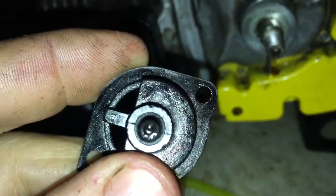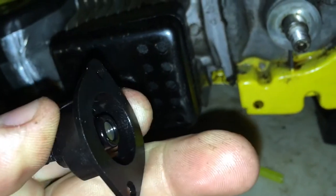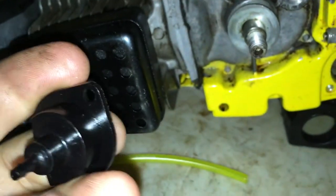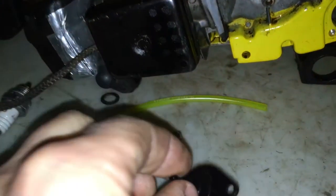I don't think there's a duck bill in here - I think it's just a ball and spring. You might be able to take a small punch and punch it out. I just tapped it around, then put some more WD-40 and blew it out again. Once you put your hose on the end to test it and both valves seal, that part of it's good.